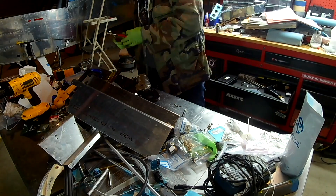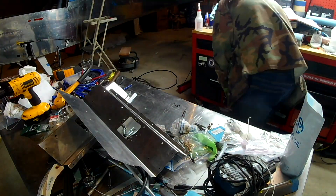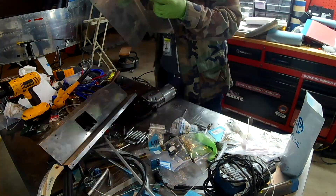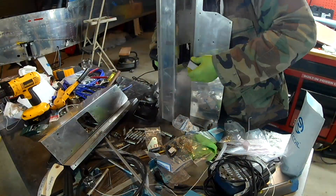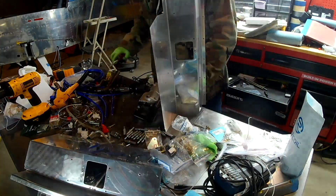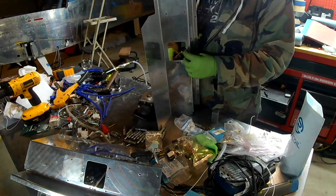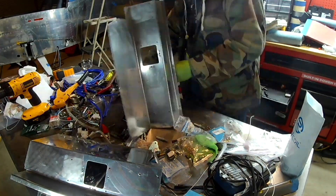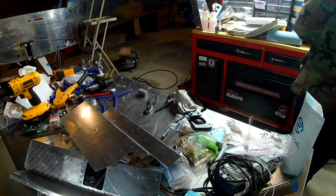I've got to get this thing flying before the end of April — I don't have time to mess with future technology. With these stock parts, nothing special: just deburr them, make sure the holes are final drilled. We are going to be adding nut plates — you can see there — for around the control stick window. There's going to be a nice boot and it needs a place to secure the boot. Next video: more miscellaneous. Thank you for joining me, everyone!